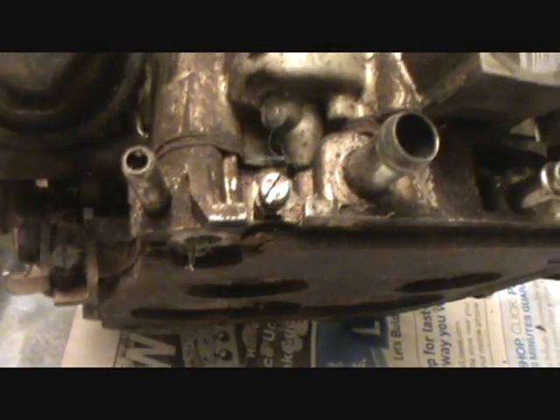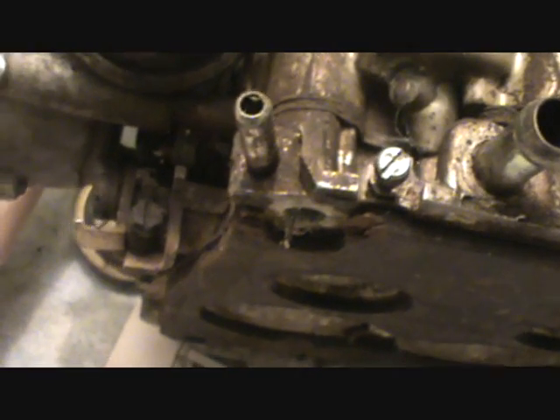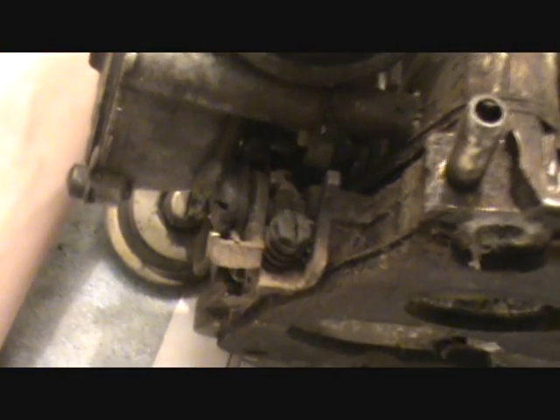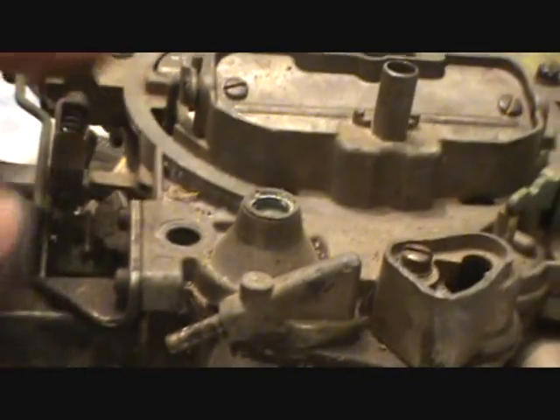The way you find the fast idle screw on one of these is you look over here at the front, on the right front of it. It's not those — those are mixture screws, which we'll get into setting mixture when I feel like doing another carburetor video. But this little dude under here — way under here — that is your fast idle speed screw for the choke system on a Quadrajet. They're all under there, every one of them. So that's how you adjust it. Because if you start adjusting the one over here when it's closed, that ain't going to do it. It's not easy to get to, but that's where they put them.